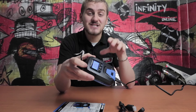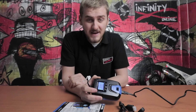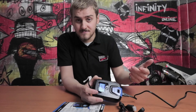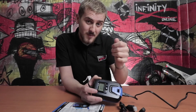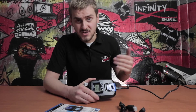The Oxamizer has a six stage management process. Step one, it does a polarity check — the Oxamizer checks that the leads are fitted the right way around on the battery so we're not going to cause any damage. Step two is a battery analysis, where it assesses the battery and determines the best method of charging. Step three is the bulk fast charge, going at a faster rate to get the battery up to about 85% capacity. Step four is the absorption charge, where it dials back the charging rate and tops the battery up to 100%. Step five is the voltage check — every hour it checks what charge level the battery is at. And step six is maintain mode: if the voltage check finds the battery is a bit too low, it applies an appropriate charge to bring it back up to 100%.